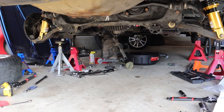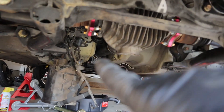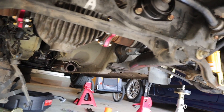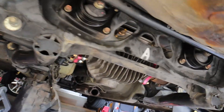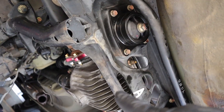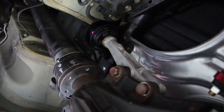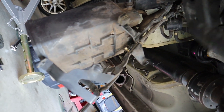This entire time I thought it was recording and it wasn't — good job, me. So what has happened: installed the axles with the spacers, got the castle nut torqued on to the lower ball joint on both sides, got the prop shaft torqued onto the diff. I went through and made sure all the diff mounts were torqued to spec — the ones back here and those ones as well. Then I went through and torqued the big 32-millimeter nut at the end of the axle on both sides. Now it's time to tackle the evap system, which is kind of the last thing I have to do.